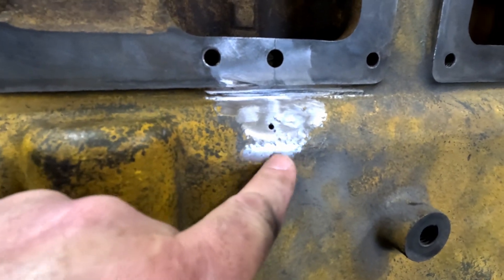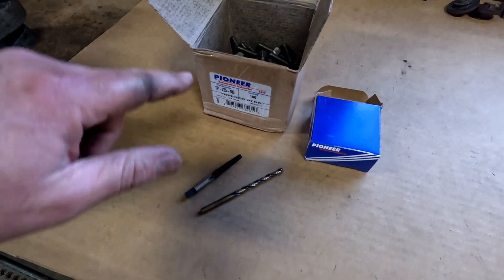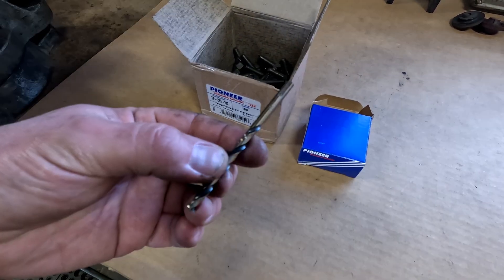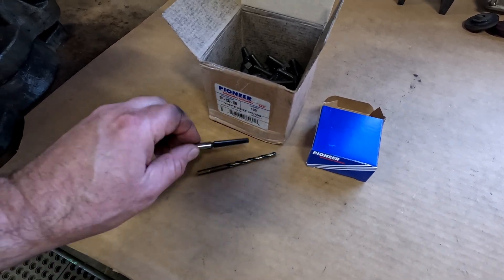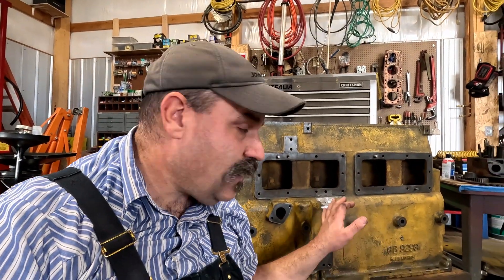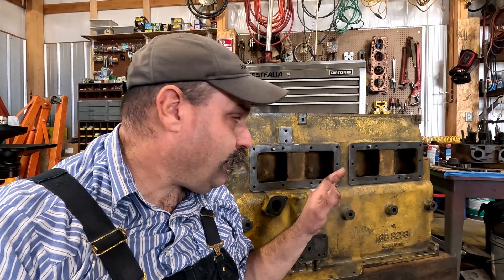A lot of folks have recommended that we drill this out and maybe metal stitch it. I got a set of taper plugs from Pioneer Automotive Industries — actually found these on eBay. Comes with a 13/64th drill and a tapered pipe thread tap. There are proprietary methods to metal stitch this that would probably work better, but the cost is way too high and the availability just isn't there — several weeks out before we could even get them. We got the sleeves in and we're ready to put the crankshaft and the bearings back in, so we're going to go ahead and metal stitch this.